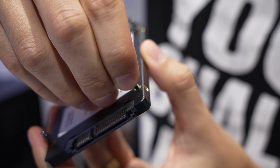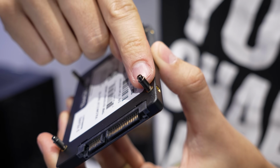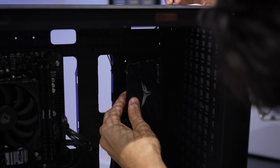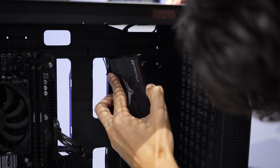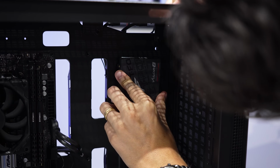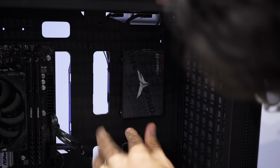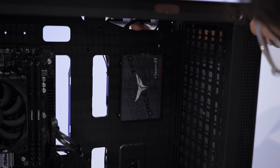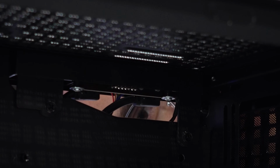Deepcool have given us these small standoffs to screw into the bottom of our 2.5-inch drive. You can see they have this little ridge toward the top, and if you follow me this way, Raymond, all we need to do is slide this straight in to these included rubber standoffs, like so. And there we go. It just kind of sits like that. And I think we can run our power and SATA data cables through this top cutout. Not entirely sure it's gonna work that way, but we're gonna give it a shot.